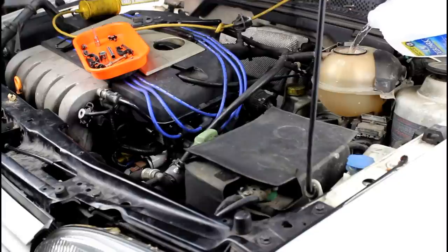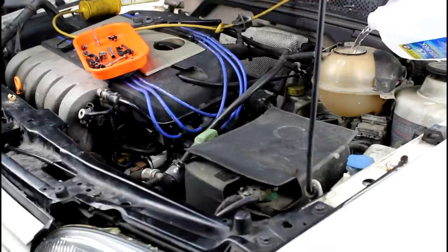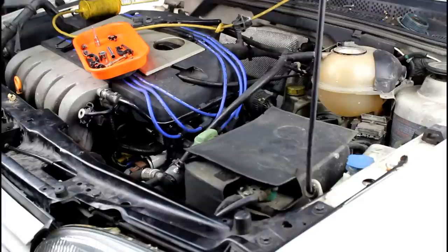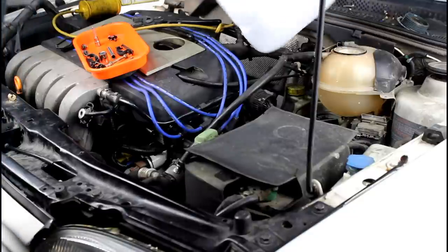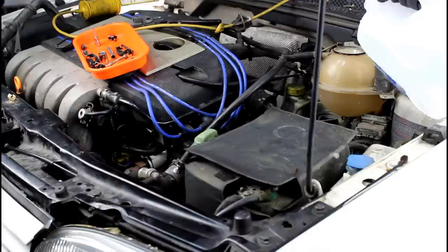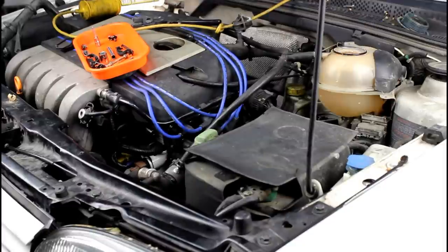We lost a lot of coolant — basically emptying the radiator and most of the coolant in the engine, so we're just going to take our time filling this up. Another thing that helps bleed air out of the cooling system a little faster is to raise the front of the vehicle — that'll help the air bubble up to the top, best done while the vehicle is running. You can also squeeze one of the radiator hoses to speed up the process. I don't hear anything pouring on the floor, so I must have got all the coolant lines on — that's happened to me more than once where I filled it and coolant came pouring back out.